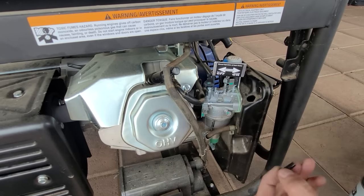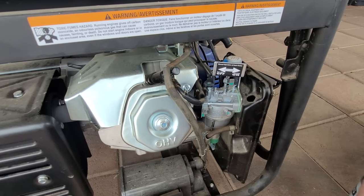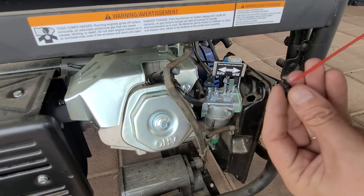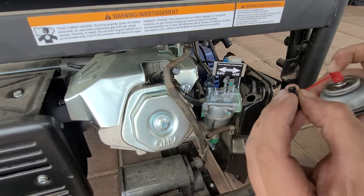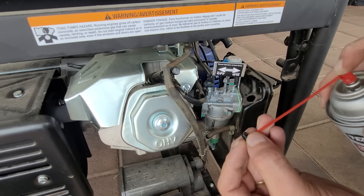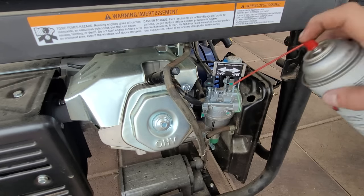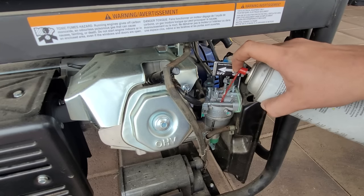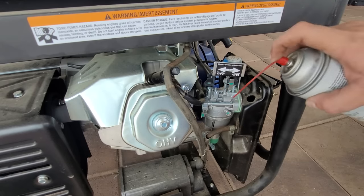You could do this without taking the carburetor off. It feels a little warm, nothing to be too worried about. Take your carb carburetor cleaner and spray into here — cover one hole with one finger, insert the red tube in the other. Back it out a little bit and see how you see that coming out. We cleared out anything blocking the pilot jet. Now spray up in here. You can tell this thing has brand new gaskets, so it's not the gaskets — it's not getting too much air.